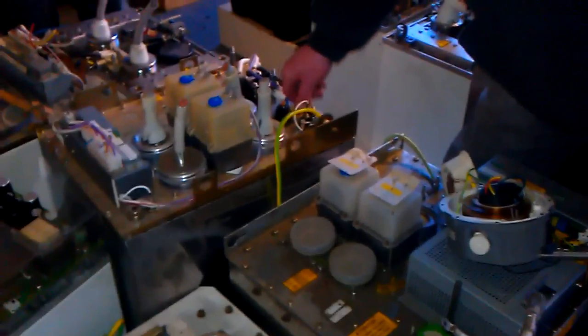The only thing you have to do, if they're going to get hot... I've picked a bad example. If I pick a Philips one, you have to loosen the screw when you install it. So that screw there. Because as the oil gets hot and cold, obviously it expands.